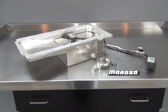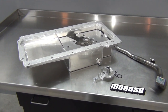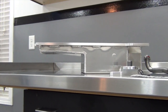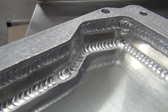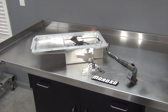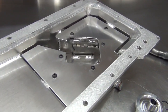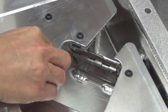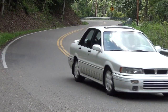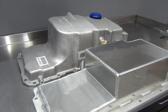Next up is the oil pan. In order to fit this engine so low in the chassis, a special low-profile oil pan must be used for proper steering rack and ground clearance. There are a couple of options available, and you can even modify a stock F-body pan if you're brave enough, but I chose the Moroso aluminum V8 conversion pan from Flying Miata. The Moroso reputation speaks for itself, and this pan looks impressive and well made. The setup includes the pan, your choice of aluminum or steel, a new pickup tube, the screw-on oil filter housing, and the correct oil filter that doesn't hang below the pan. It offers internal baffles with hinged trap doors to ensure the best oil supply possible when you're on the track or flying around mountain roads like a maniac. Take a look at it next to the factory LS3 pan that came with our engine.